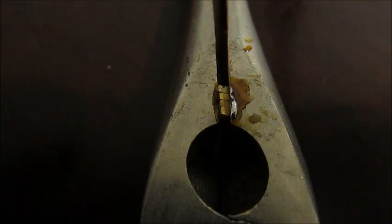But once you get them, the wire on each end, you know, add your resistor. It would help if you have a power supply. Maybe set it at something like 6 volts, and a resistance of maybe 300 to start, 400 and work your way down. If you have 36 of these in line, I'd probably stop at maybe 200 ohms in the testing phase, and then go from there.